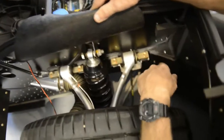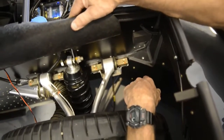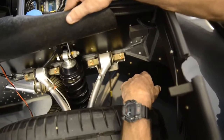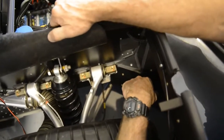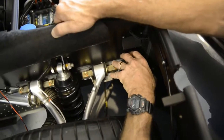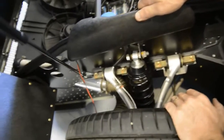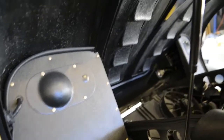I did a thrust line on the bottom of the car and was able to do toe-in, toe-out, and all that. The alignment on this car is got to be dead on — you really have to dial it in, to within a thirty-second of an inch. It's insane.